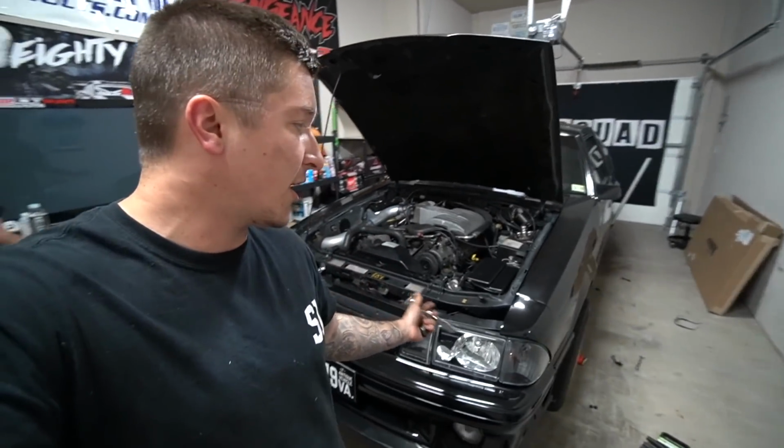Good job. I was underneath the car for a hot minute, super excited. Everything came off. We can save the bolts, reuse them and everything. But come to find out, we gotta figure out how to take this EGR tube off of the exhaust, and it's not budging. But since we have the pipe off the headers, maybe we can do a little open header start. It's only 9:30. Open header start, here we go.